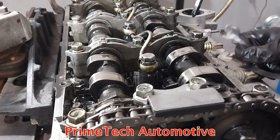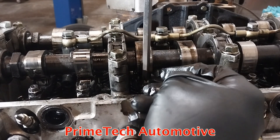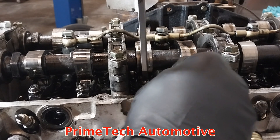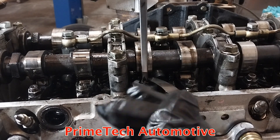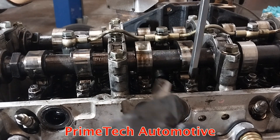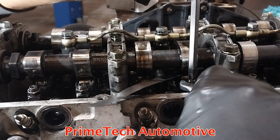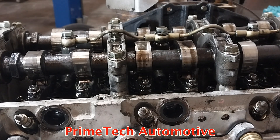I'll do the others the same way. That one's too loose, so keep tightening until you feel some resistance to the feeler gauge. Don't go really hard or too tight — you won't have any clearance. Once it feels okay, hold the middle screw and lock the lock nut. That's the last one on this cycle — beautiful, perfect.